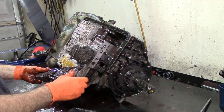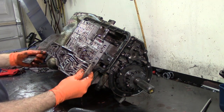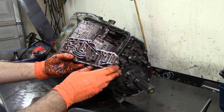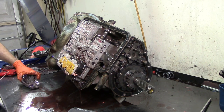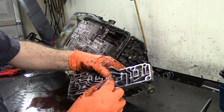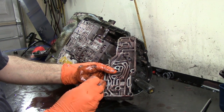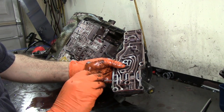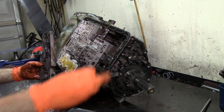If the transmission was having all the gears before and you had a converter problem, and after you worked on it you have some other problems — buddy, you created those problems. Here we see two valves and they don't look stuck. You always want to check with a flat-head screwdriver — a little tiny screwdriver — just have a feel for it. With a lot of metal like that you will feel them kind of scratchy. If you do, clean them up first, take your valve out, polish the bore, put the valve back in.